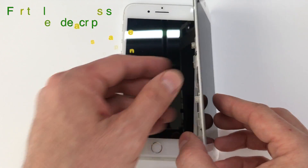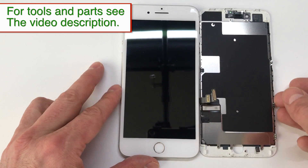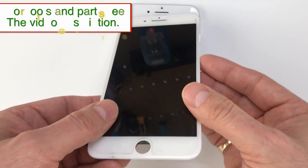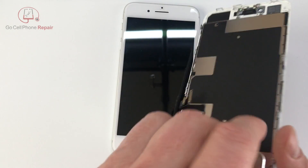The iPhone 8 Plus opens up from left to right, something like a book. We have cables here and here that you need to watch out for on the inside, and a set of clips that go along the top that lock in underneath the housing on the frame. So we have to make sure that we slide this down slightly before we start prying it open.